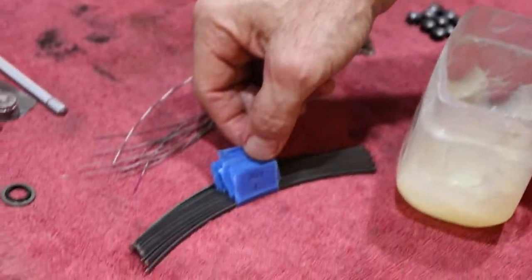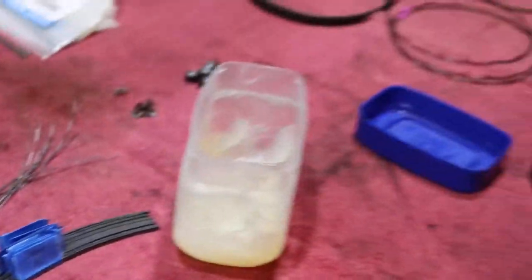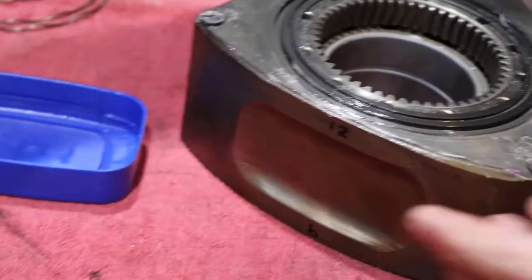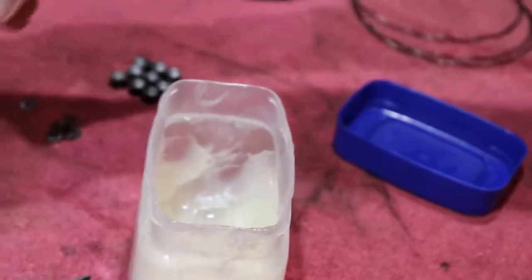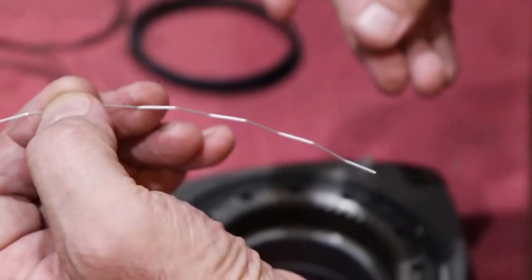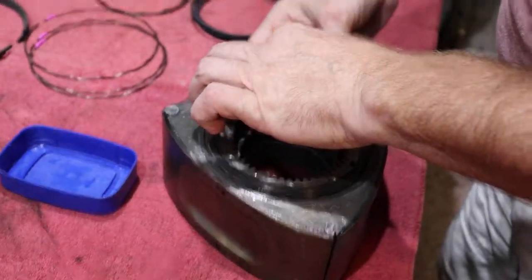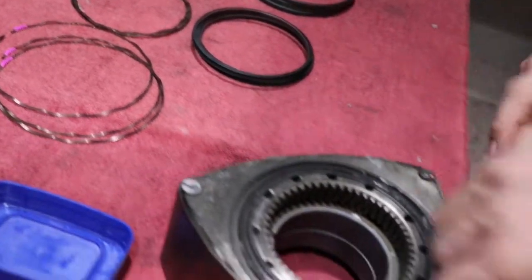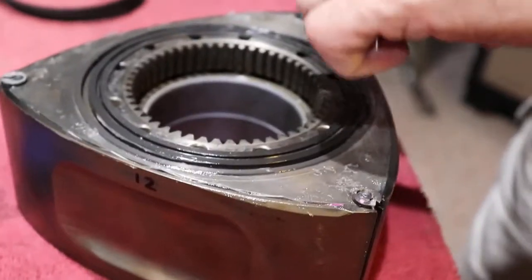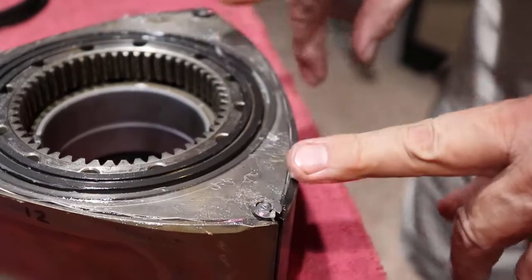Notice here I've got my side seals all numbered and pre-clearanced. I wrote on each face of the rotor the corresponding groove number. Every OEM part has a color on it — pink to indicate up. Whenever you see the color, the color goes up. You see the pink tip corresponds to the pink dot on the corner seal. That is called ISO 9000 plus process.